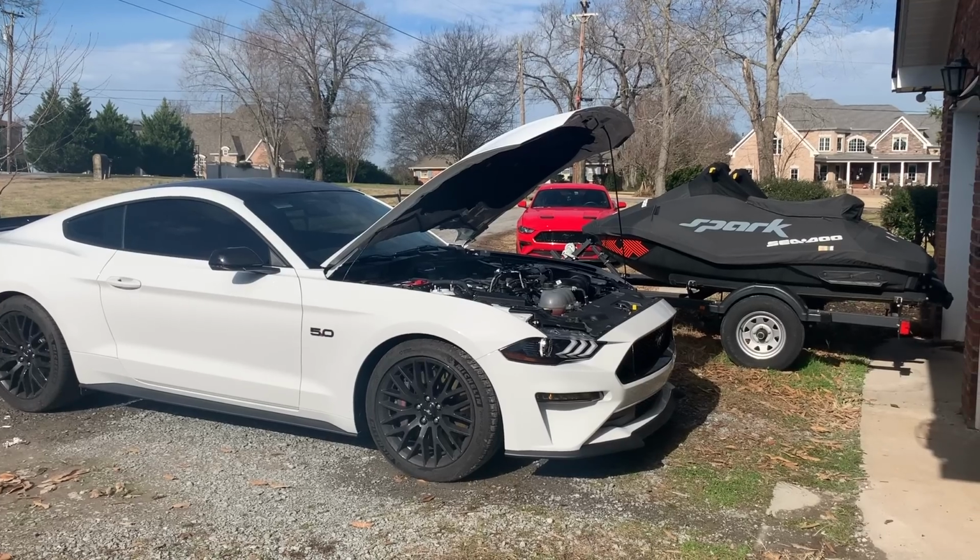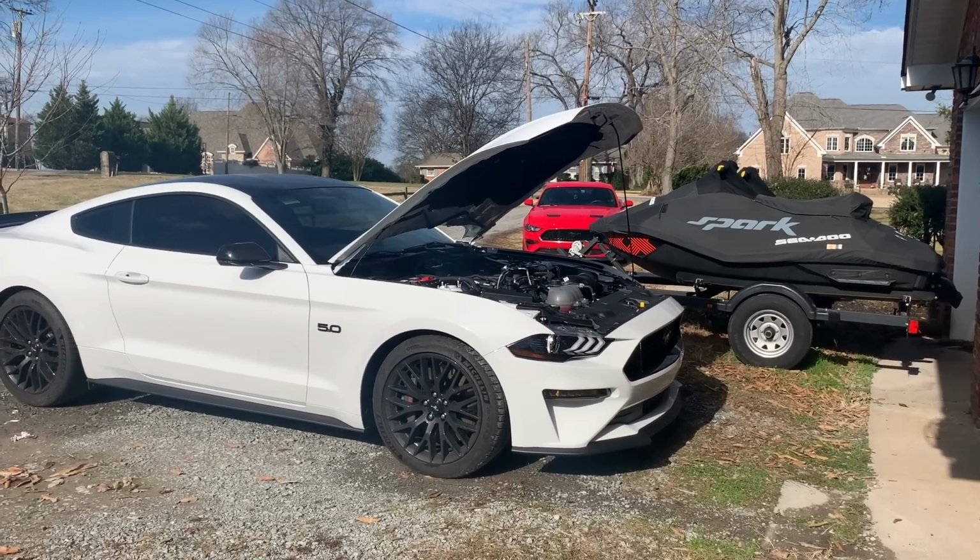Other than that, this thing has factory cold air intake, all that. It's 100% stock, except for the axle back and the suitcase delete. 800 bucks is about what people would spend for an intake and a tuner. And this has no tune on it. Like I said, we've already done a 50 shot on it. The only thing we did to compensate for the nitrous is we are running 104 octane right now, and we did go 2 steps colder on the spark plugs.